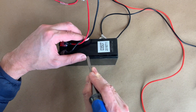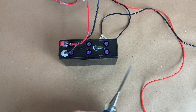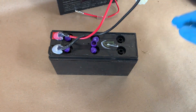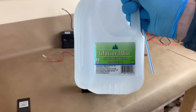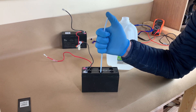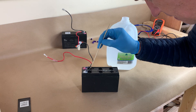This battery needs to be restored. Let's take off the top cover and remove the rubber caps. The caps look sucked in, which tells us that the cells are dry. We need to refill them with distilled water. I got a gallon of distilled water and used a straw to put water inside the cells. You could also use a syringe to do that. I also used a small stick to extract air bubbles from the cells.